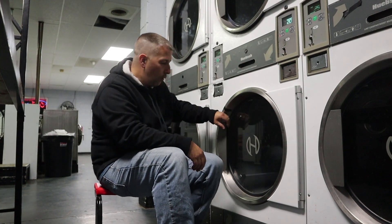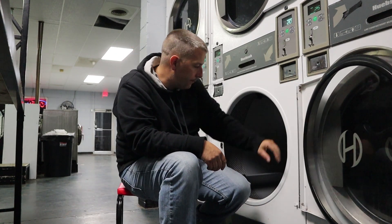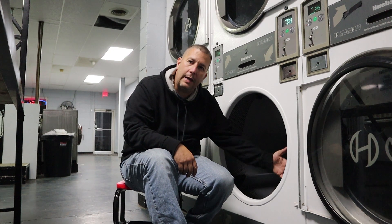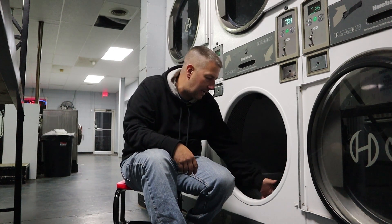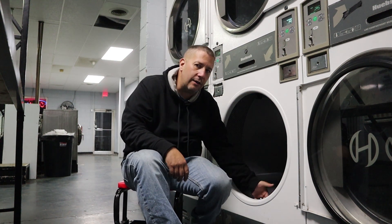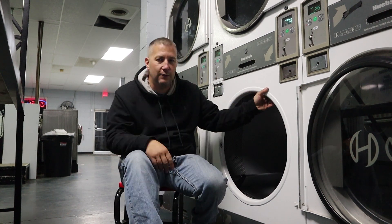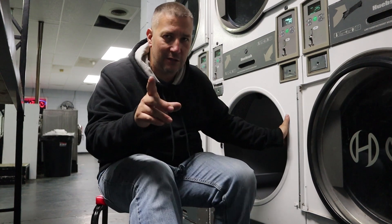So your dryer is not making a very good noise. I can feel it just by putting my hand inside this door. Basically this drum has dropped and it's not riding on the bottom of this door frame — it's riding on the top of the door frame. When we take this cover off you're going to see what this does to a dryer. See that? That's not good. There should be a gap there — it's riding against that, metal on metal.